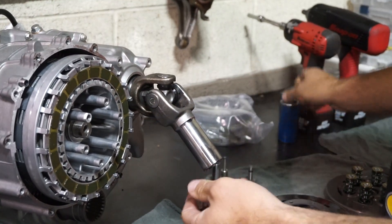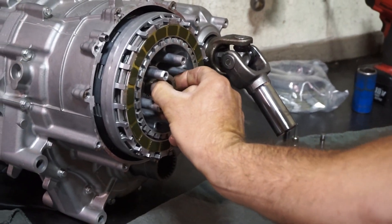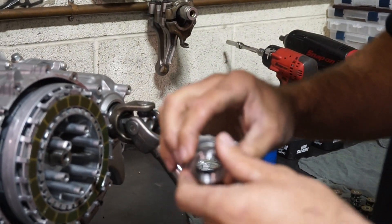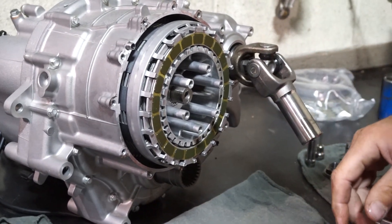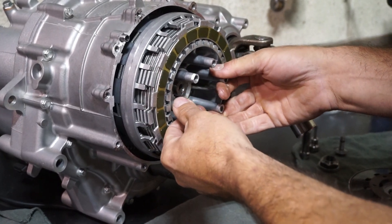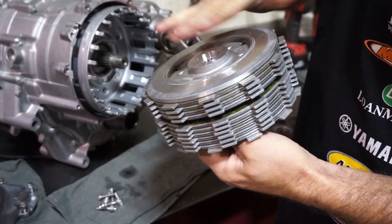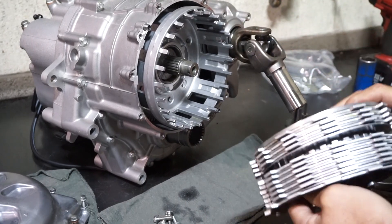Take that nut off — you'll need an impact or something to get in there. There are two washers behind the nut. You'll see on the washer it says 'out' — that one goes right at the nut, and then there's another flat washer behind it, so make sure you pull off two washers. Put those aside. Once you have that nut and washers off, you can just grab this and pull the whole clutch assembly out. There shouldn't be anything behind here — it should just be flat. The basket stays, everything else stays — this is all we need right here.